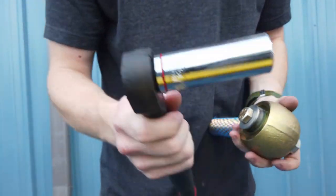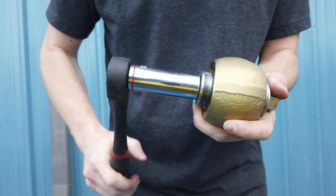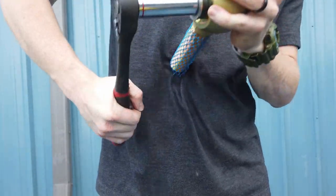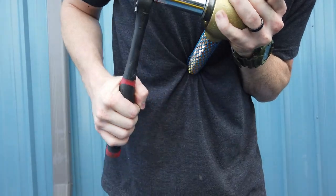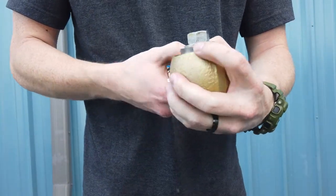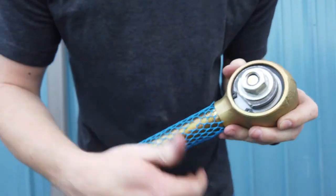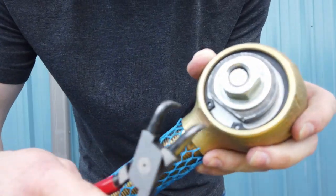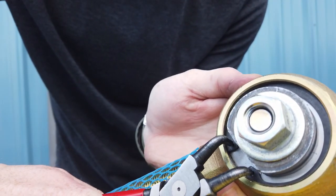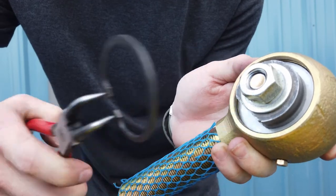We've got the rebuild tool in our joint and the ratchet here. We're going to tighten this up. A lot of times you can do this without even using the wrench — you just need the wrench to get it started. About three good cranks, and this is probably good to go. You want that flat part of the thick washer to be where your snap ring opening is. Now take your snap ring pliers, insert them in here, get this snap ring out — and as you can see, when I squeeze this, there she goes. That's as tight as I want to get this nut, just enough to get it out.